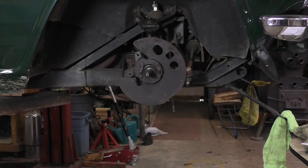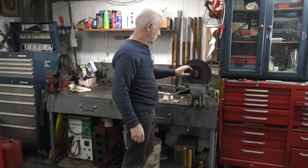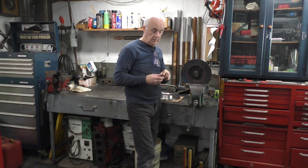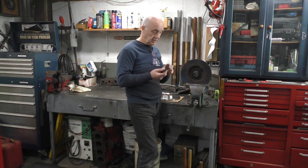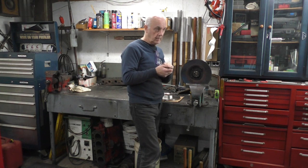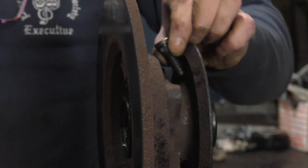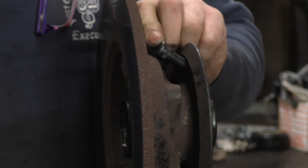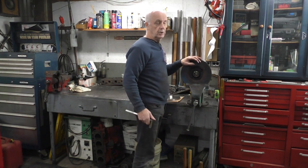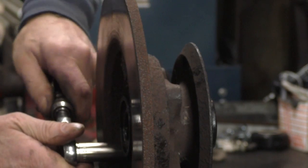I've taken the rotor off the TR — I'm going to change it, I have a new one here. I also need to take the rotor off the hub anyway because I have to fit new wheel studs for the steel wheels. The steel wheels have longer wheel studs than the wire wheels because the wire wheels use adapters, and the longer studs interfere with the back of the spoked wheels when they go on the splines. I can't get the studs in with the rotor on, and since I'm already taking it off, the old rotor needs to go for certification anyway so I'm just putting on new rotors.